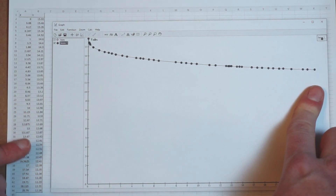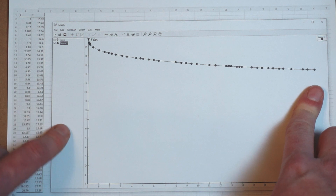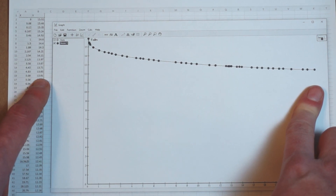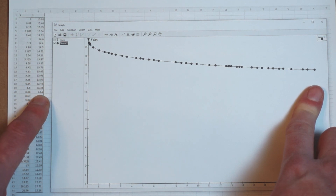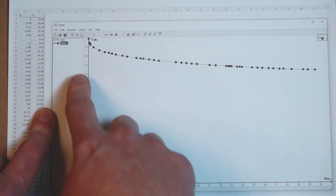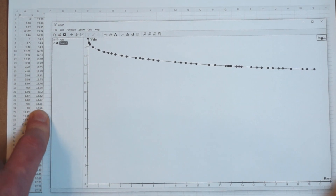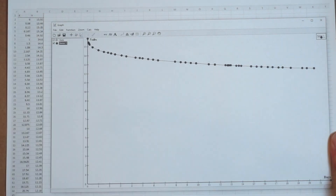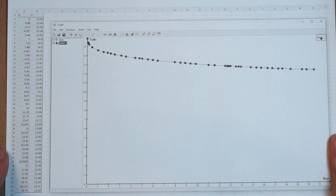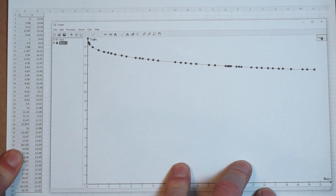From 13.6 volts — 13.61 volts right here — at just over five days in, it didn't drop down to 13.01 volts until four and a half days later. So it holds its charge pretty well in the areas we'll be using it. I thought about using a booster circuit to charge it up to 16 volts to give it that extra oomph, but really I don't need it — the LTD is not that hard to start.